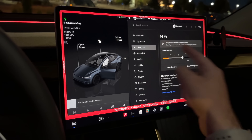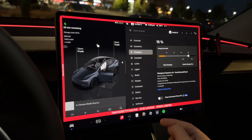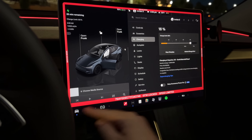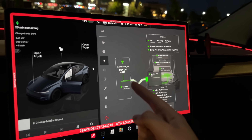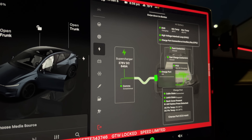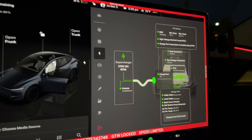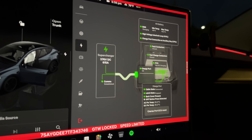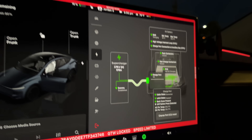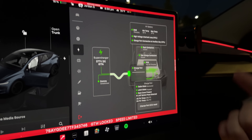Going in to make sure we don't have a charging limit set, because we don't want to stop charging suddenly. Back here in service mode, we can keep an eye on our voltage and amperage. We're requesting nearly 650 amps, which is crazy — that's Tesla things. We'll see how much our battery and pin temperatures start to climb if they do.